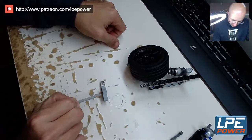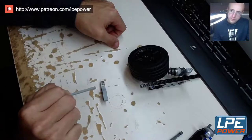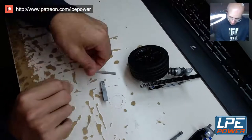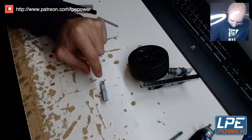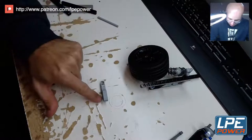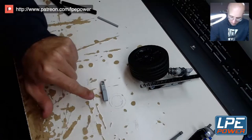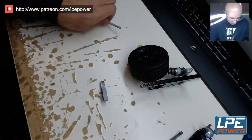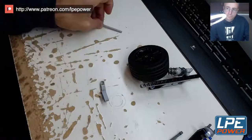We probably can do the two-step thing, and the two-step thing is exactly what is going to allow us to make the triangular shape to the back. Because the anti-roll bar is going to be in the same plane as this lower part, and the suspension bridge is going to attach to this here. And the triangular shape is gonna basically go in this plane back.